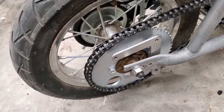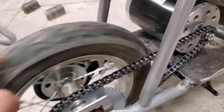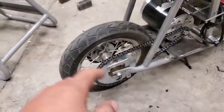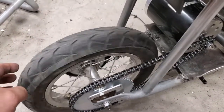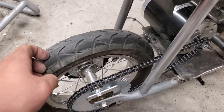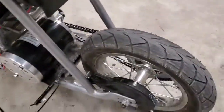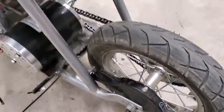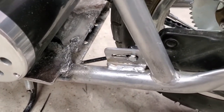The reason I wanted you to bolt it in and not weld it like the pit bike is because you can still do this — turn the wheel and the entire motor turns. It does it when going backwards. But if you go forward and hit the gas, the sprocket's turning and the thing's going. When you let go of the gas, the sprocket will stop eventually but the wheel keeps going — that gives you a lot more coasting. With the pit bike, you let off the gas and you start slowing down because the engine slows you down.